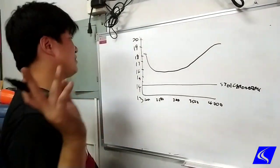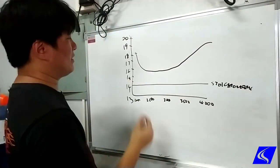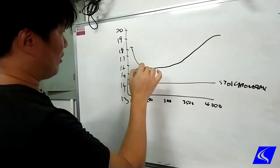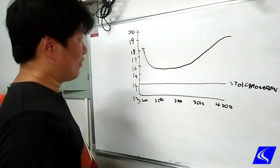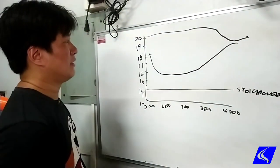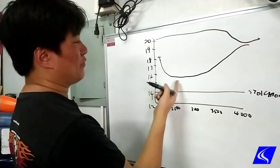So basically this Terra — what we've seen in stock form — the ECU is injecting a lot more fuel than what we normally see. The air-fuel ratio starts here at 18, which is already considered a bit rich for diesels, then goes down all the way to 16, then goes back up to about 19. Normally what we see in every other diesel in stock form, the air-fuel ratio is a straight line at 20, then dips down a little bit. This is why it's weak down low on those — but on this Terra, it's already strong down low because of this extra fuel being injected.